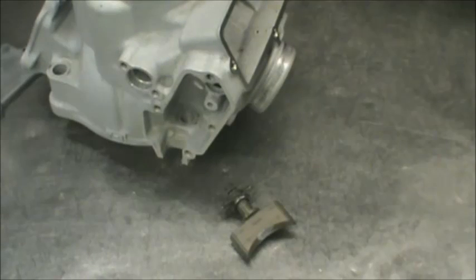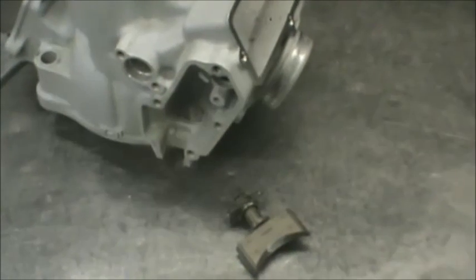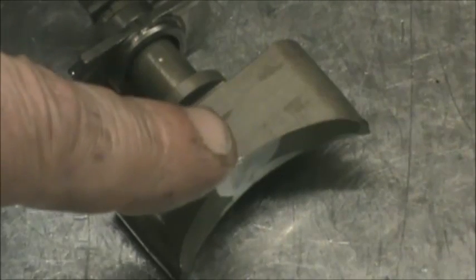I've got all my parts for my cylinder out of the ultrasonic cleaner. I'm going to do the assembly, but here's something I noticed when we took the engine apart. This is a 2013. This is the top valve for the power valves. See that wear mark? That's from rings. The rings actually bulged out into the cylinder enough to put a little wear mark on that power valve, and they're definitely hitting it.